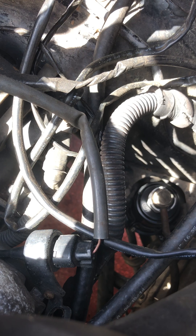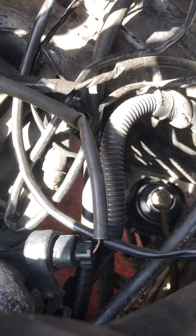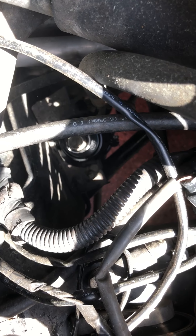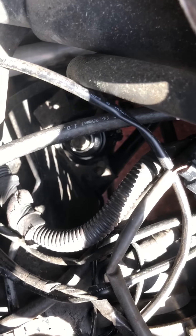Now do the same thing with the top one. Put that little guy on there — it's like a little castle nut that comes with them. Then slide this — here's the fuel line right here — so I'm basically going to slide the bolt through. Once the bolt goes through, I will then put another copper washer on the other side and then stick it in the filter.